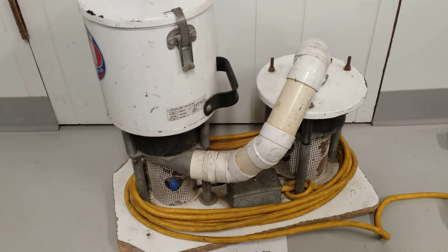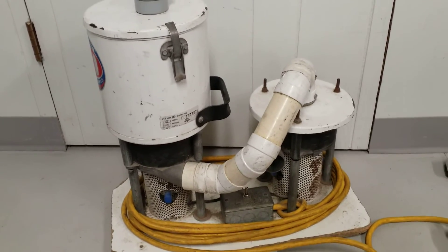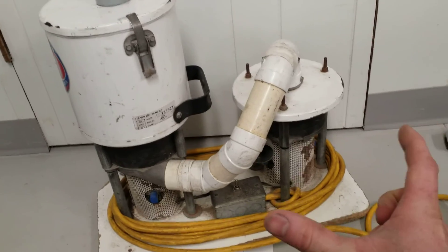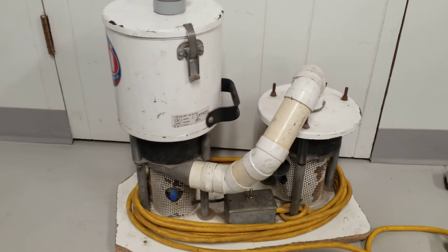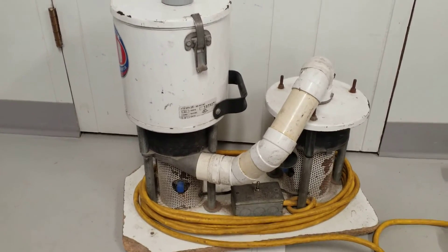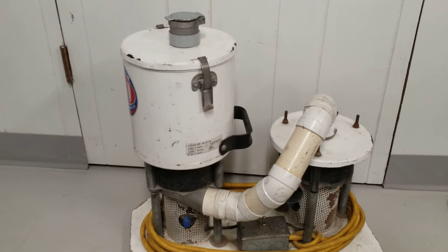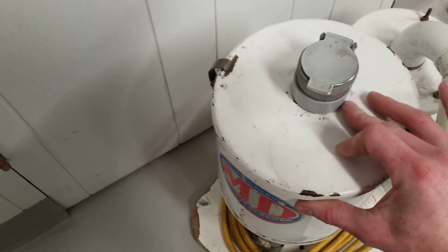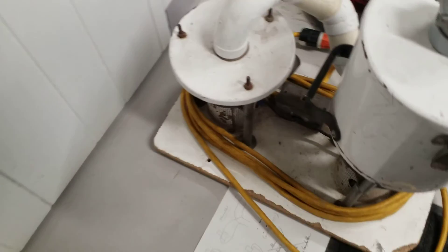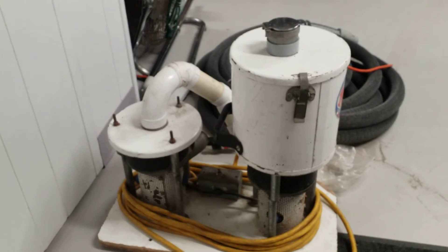The older ones — I understand MD used to build had 115334 motors, which is a larger-diameter 7.2-inch two-stage motor, and each one of those is rated at 110 inches of water lift. That unit would be at 220 inches instead. With this one on high, you can't even put a water lift gauge on it because it'll bury the needle and break your gauge, and those don't exactly grow on trees. Just thought my like-minded central vac nerds would get a kick out of my MD clean-out unit.